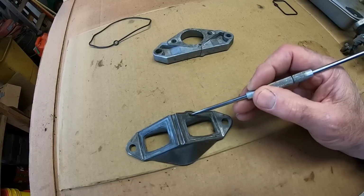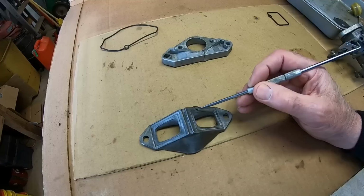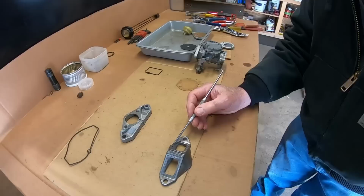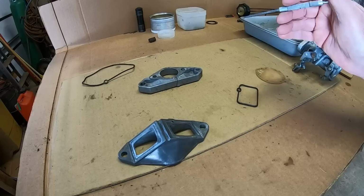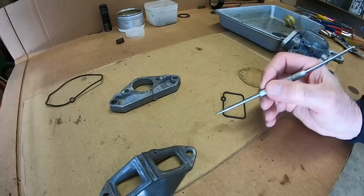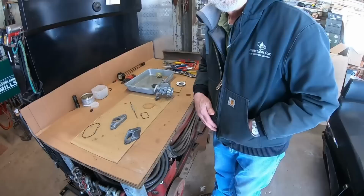And that was your fuel starving. That was enough restriction of the pulse air to give me issues operating the fuel pump diaphragm. And why I had silicone there is these gaskets go in and seat on a groove. I usually put just a couple dabs of silicone in just to hold them in place till I get them fastened down. Well, sure enough, I went around here, got a little too much, it squeezed out and covered that hole up. So we're ready for round two today then.